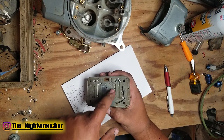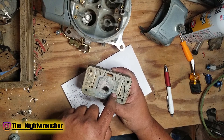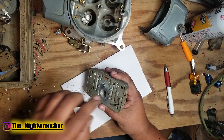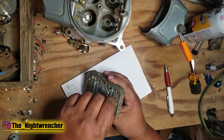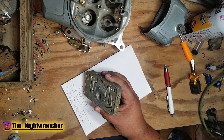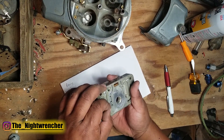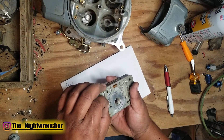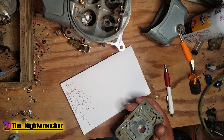As for the emulsion circuit, we have a two-hole circuit here. The holes look really big, but it's a similar situation to the idle feed restrictors — there's a smaller orifice inside of the big orifice. So same process: starting at 021 — too small. Going to 024 — a little better. Going to 026 — I can get 026 on the bottom ones but can't seem to get 026 on the top ones. The verdict is these are at 025, all four.